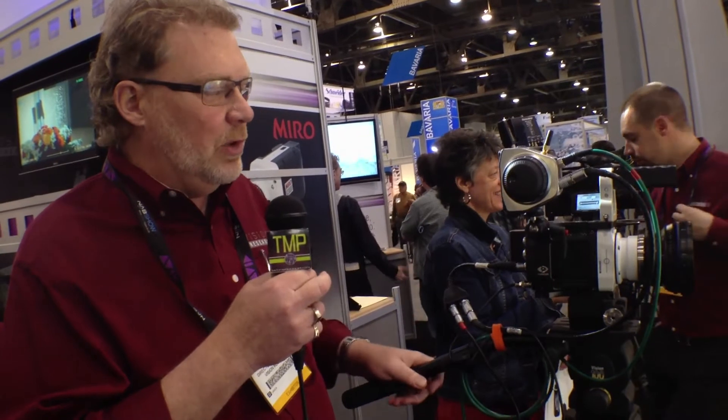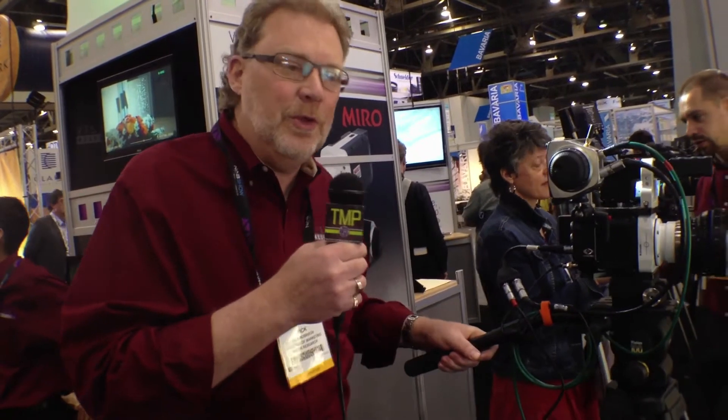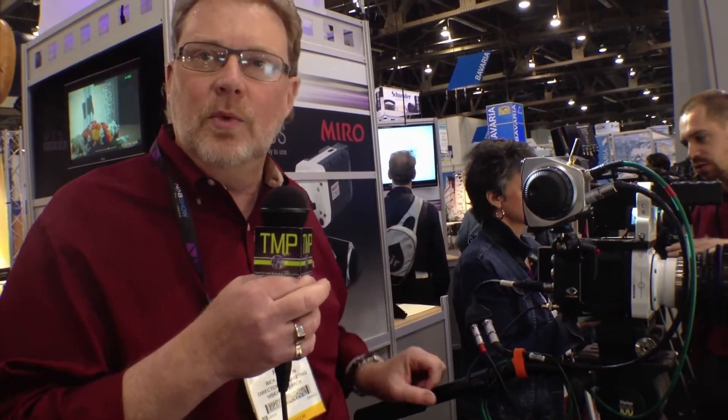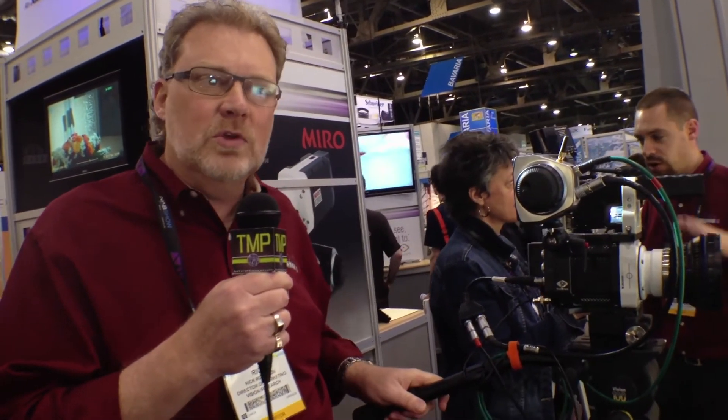So that's another big difference. There are other differences — maybe big to some people. There's a dual video output on the Flex, so you have dual-link HD-SDI, allowing you to gang them together for 4:4:4 video, or have two independent outputs — one going to a monitor and another to a viewfinder or remote control device. The Flex also has a GenLock capability for GenLocking the video output; this camera doesn't, so you'd need an external GenLock. There are a lot of things in the electronics of the Flex that aren't available here, primarily due to the form factor.